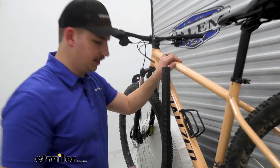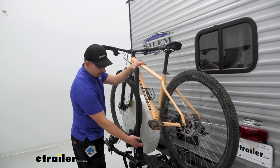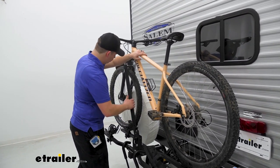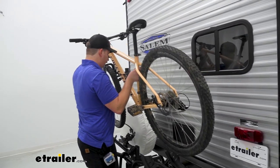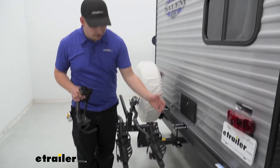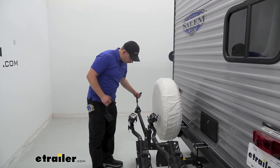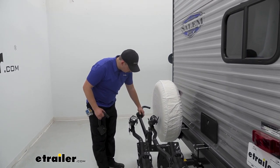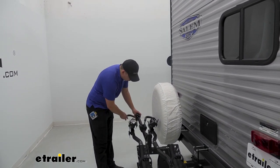Again, I would maybe just remove the spare tire. At this point you can lift the bike up and over the center mast, or if you've got a free hand, pull the lever at the bottom to fold the mast down out of the way — then you don't have to lift the bike nearly as high to get it away from the rack. I always like to replace the straps so they're not freely moving around and add the hooks back onto the center mast while it's down, making sure you've got them in the proper orientation. They don't need to go down all the way, just enough to be out of the way.